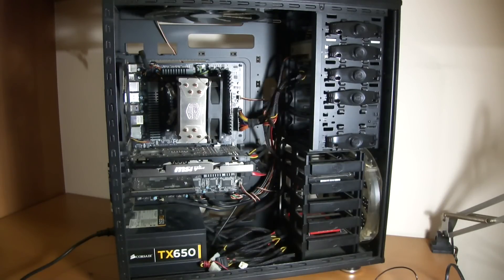You will see about two pins usually called PW plus and PW minus. Search on your motherboard for these two pins and then you must short these two pins. Let's do this on my motherboard.